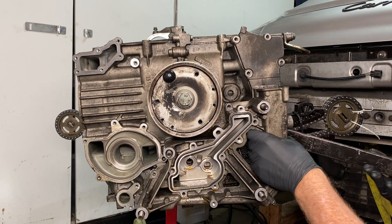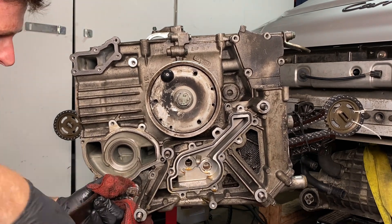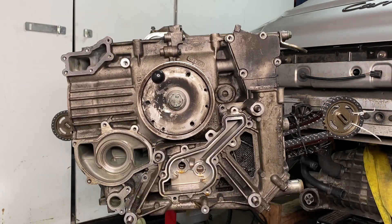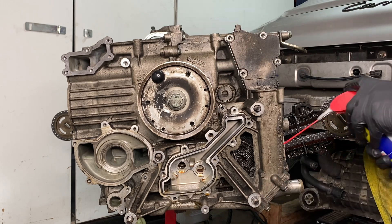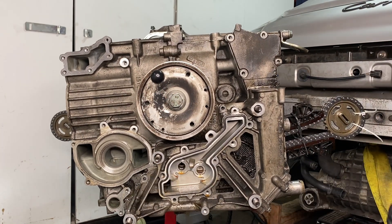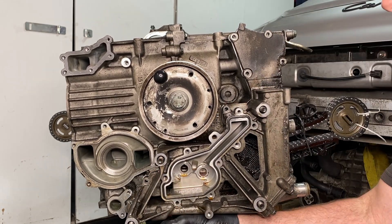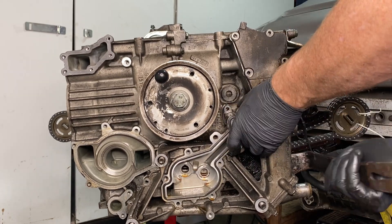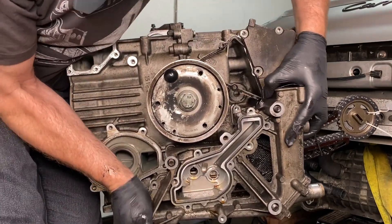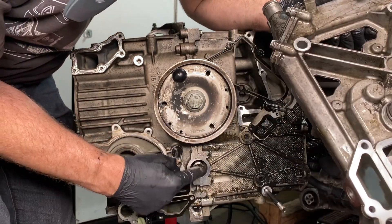In the end I did realize that it's kind of rotating around a pivot point around where the IMS port runs the oil pump. There are two black O-rings there, and I'm zapping that with WD-40, plus anywhere else I think I can get some capillary action to hopefully help me out. That did seem to help. You can see when I get on the bottom that really seems to push it out. Then just manhandling, just wrenching on it — and there you can see the two O-rings. That really holds it in place very well; that was the final struggle.